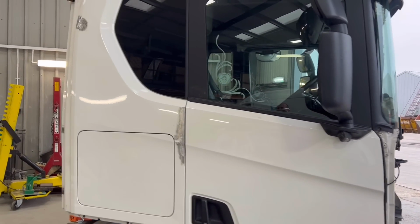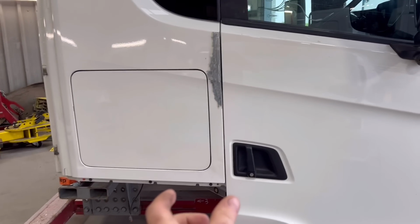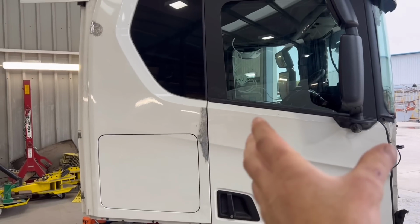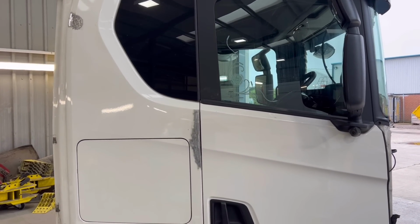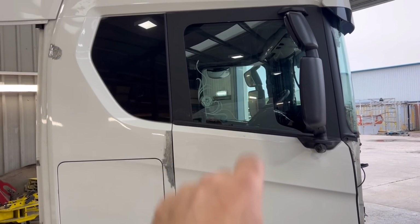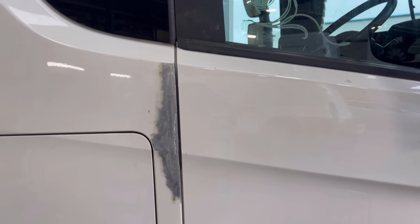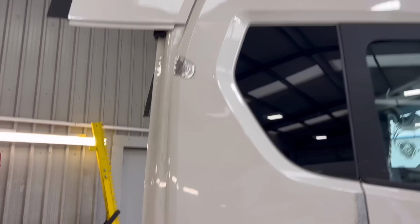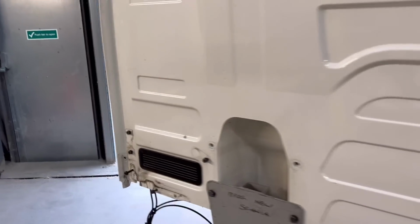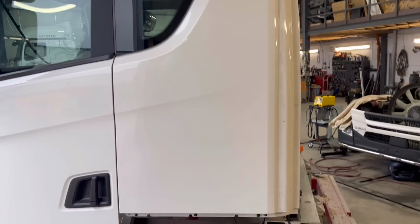All done. Done and dusted, apart from painting, all the gaps look good. I pulled it down, and I did have to adjust that door up a touch, because the distance from the hole there to the hole there was about a mill out, and that door was lower compared to the other side anyway. The gap is all good, perfectly. Just have to apply some body filler in areas there, just dress that up, and that's probably going to be in the next video. The same on this side. It's not a lot, there's a little bit of damage there and damage on that panel. Apart from that, that's all good.